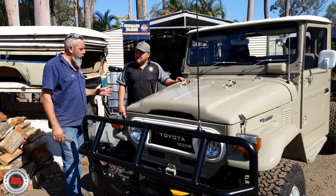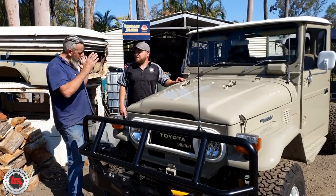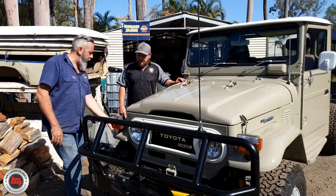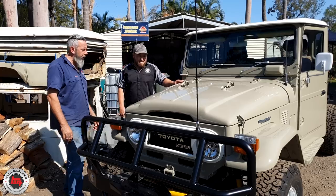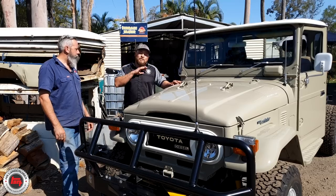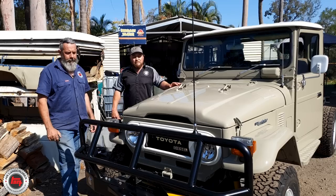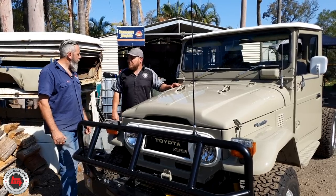This was a 1977 and it had the wrong rear axle. With the five-speed and to put the backing plates from a 60 series on for disc brakes, we've swapped the axle out. We don't just swap the axles and throw the disc brakes on — we fully rebuilt the axles, all the bearings, new everything. And there's one custom throttle cable: they don't make throttle cables for a 12HT anymore, so we buy a universal kit, do some trimming and cutting, and put solderless nipples on. They work really well — great job.